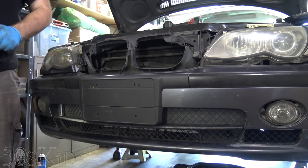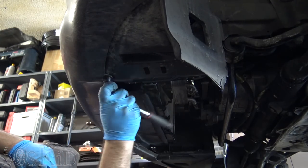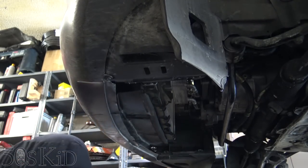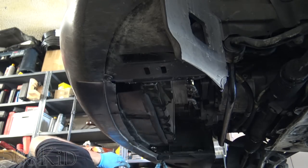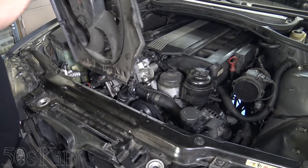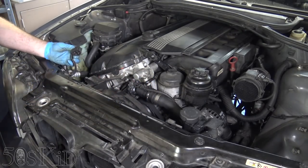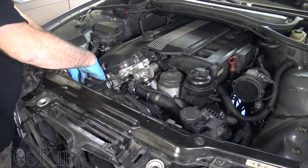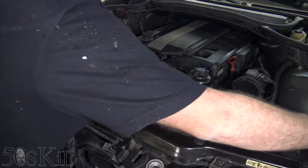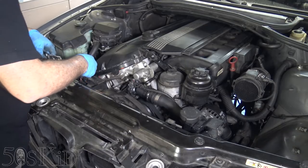This thing is dead — I can feel it dying. I don't know if these are supposed to be screws or maybe push fasteners originally came with these. I didn't have these splash panels — I got them from a junkyard and maybe I put the little retainer clips on the bottom of them and put the screws on myself. I really don't know. And now the easiest part: we just lay our fan right in there where the old fan went. Then you just use the same connector — connect that up. The little air sensor for the cooling system. We just got to replace this bolt right here; it just kind of holds the fan in place.